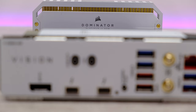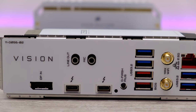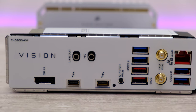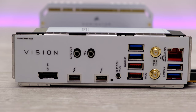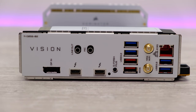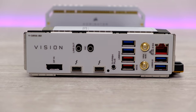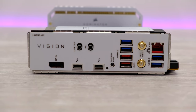Checking out that all-important rear I/O panel then. Clearly the standout feature is the pair of Thunderbolt 4 ports, which can be daisy-chained to a whole bunch of devices including Thunderbolt 4 hubs and network adapters. The key thing here is that there is a DisplayPort input, which can go from your graphics card into the port on the left, so you can output everything — including your graphics card output — over one of the Thunderbolt 4 ports. If you don't plan on using Thunderbolt, you still get a total of six Type-A USB ports, some being USB 3.2 Gen 2, plus Type-C compatibility, audio outputs, and aerials for the onboard Wi-Fi.